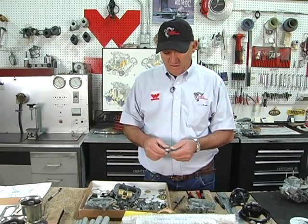And there's a tremendous amount of data out there available on whatever you're driving. If you're driving a Morris Minor pickup with a DGV on it, there's lots of data telling you they normally run a 125 main jet and F6, whatever the calibrated parts are. That information gives you the ability to buy a carburetor from somewhere and get it close to a starting point. But don't forget to dial it in.